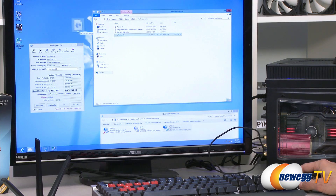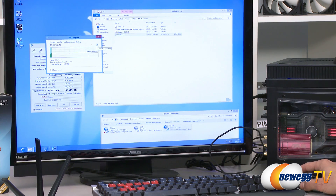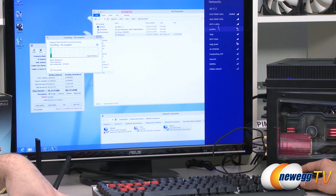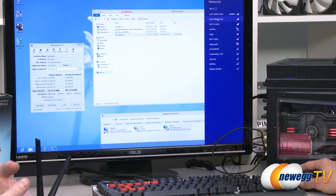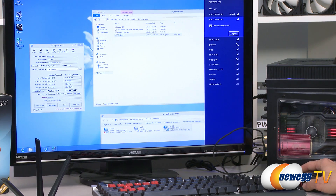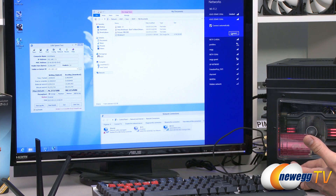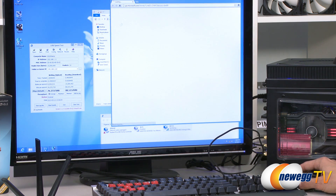Let's take a look at a 4 gigabyte file being transferred over the network to see how long that takes. We're jumping around a bit, but about nine to ten minutes — so we're looking at around 10 megabytes per second. Remember, this is 2.4 gigahertz. That's because we're currently at Newegg and we have many wireless devices and access points, so there's a lot of interference going on. That's another benefit of 802.11 AC because it runs on the 5 gigahertz band, which for the time being is a lot less crowded than 2.4 gigahertz. Let's take one more example before AC — 802.11 N also supports the 5 gigahertz band, so let's connect there and see what kind of improvement that gives us.